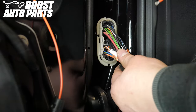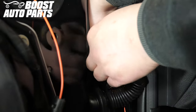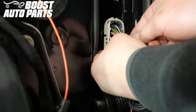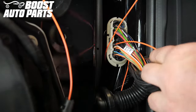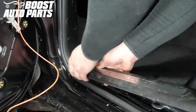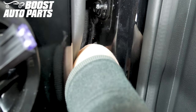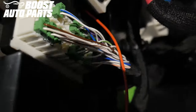Pull the wire through the door. Locate the area in the middle of the connector — there may be a black cable going through it. Run the orange running light wire underneath the black cable through the connector and pull the wire all the way through. Using your hands or a trim removal tool, remove the kick panel. Feed the orange wire through into the cab of the vehicle — there should be an opening on the cab side where the wire can be pulled through. On the driver side, this is located by the parking brake. Pull the wire through into the cab.